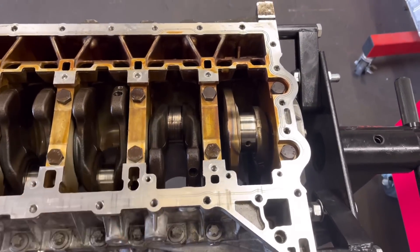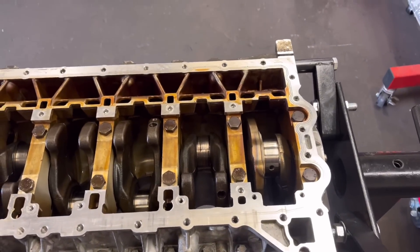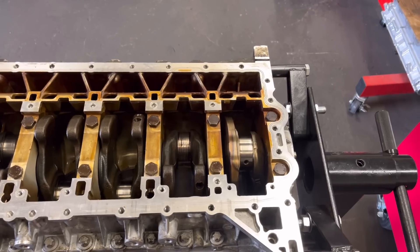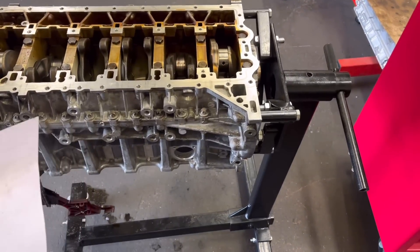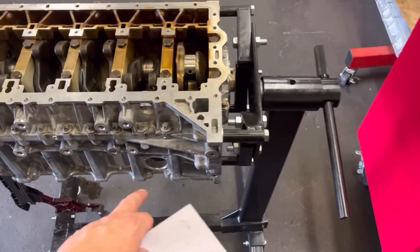So that's probably going to be about half a mil down. But even if it's not and it's grindable, the crank's going to be bent. And these days, as we've said before, we just don't get involved with straightening cranks anymore - it's not worth it. So he's gone off to source another crank. As soon as that arrives, we're going to get this all stripped, and he's going to use this block, so I'm just going to measure the bores.